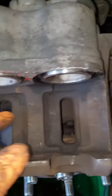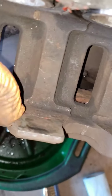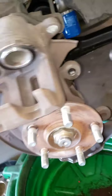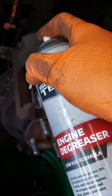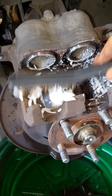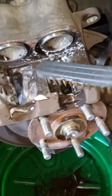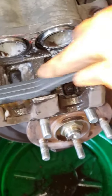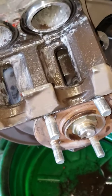I'm going to do some more cleaning on the outside of the caliper, using a little blade to scrape off all the junk built up on it, then a wire brush with degreaser. After that I'll clean with brake cleaner since it dries faster. I'll keep cleaning — no need to show all of that.